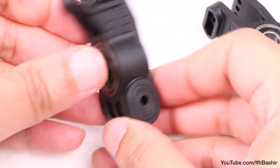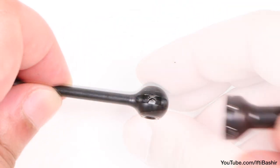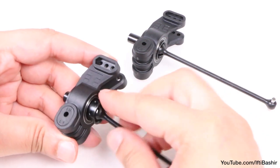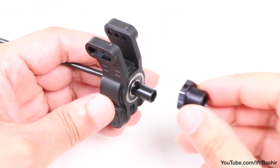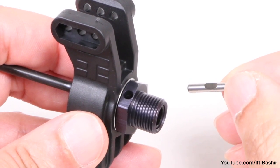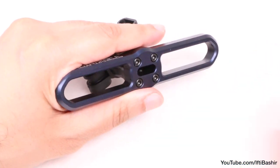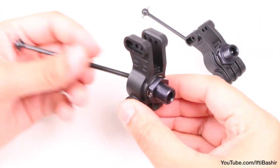With both hubs now complete, we can move on to the CVDs. Starting with the drive shaft, we insert the first piece so that the hole is lined up straight from top to bottom, before covering with the stub axle and dropping in a retaining pin. This can now be inserted into one of the two hubs we've already prepared. Complete the same process for the opposite side, building up the CVD and pushing into the second hub. Turn both, making sure they are completely free. Next, drop one of the two 17mm wheel hexes onto the axle, aligning the holes. Drop in a retaining pin — notice the pin has a flat edge in the middle which needs to face outwards so we can insert a set screw to lock it into place. Remember to apply some thread lock to the set screw and tighten down. You may find it easier to use a 17mm wrench to hold the hex in place. Repeat the same steps for the opposite side, and our rear hubs and drive shafts are complete.